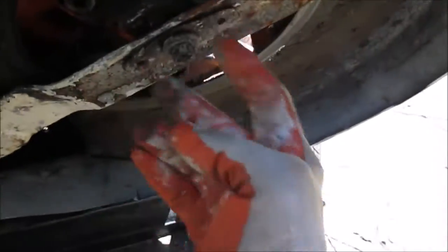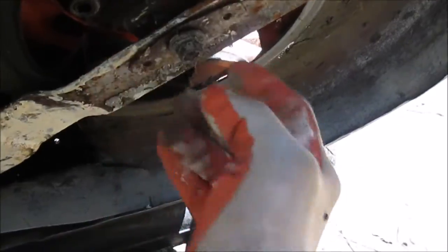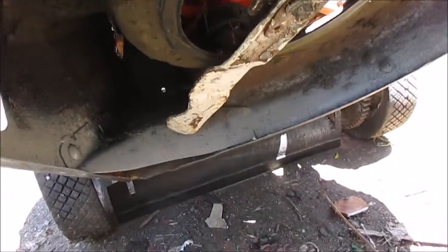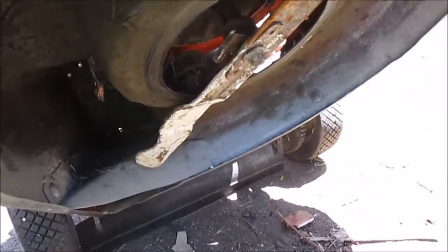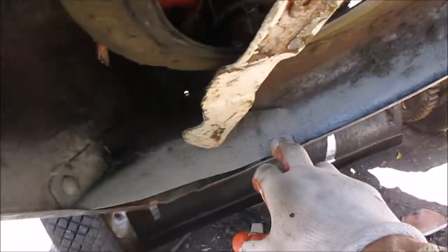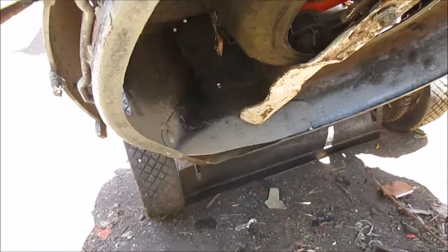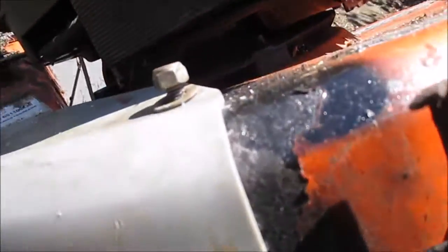...the other blade I had had this little big washer that went inside the little holes. So this washer is actually holding it inside this hole inside the blade, just like this — holding it in place. I cleaned up the edge and I've got rust prevention primer on it to save that, because the most common problem with these things is the deck rusts out over time.